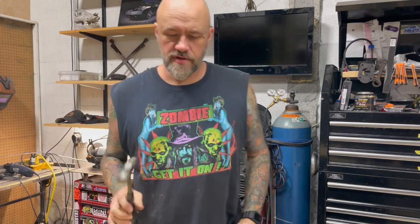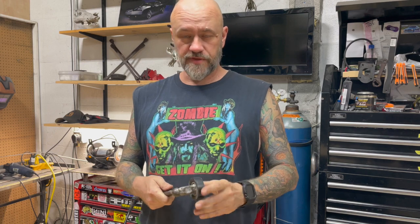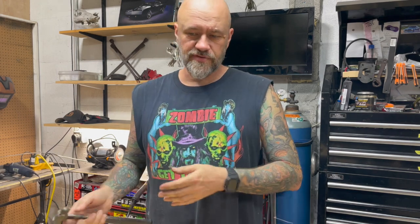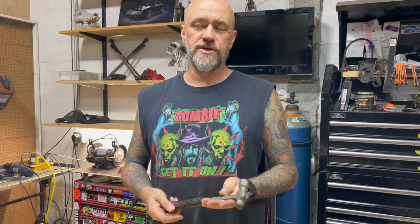What's up, humans? Today's little story goes back to when I got the car. Nothing worked. The pedals didn't work. They're actually all rusted together. And in order to make it work, I took them out and got them in a vise, and I just beat the crap out of them and used penetrating oil and stuff until they all worked independently, because they were basically one pedal working. And so I took it out, got it back in. It worked. It's worked for a few years, pretty good.